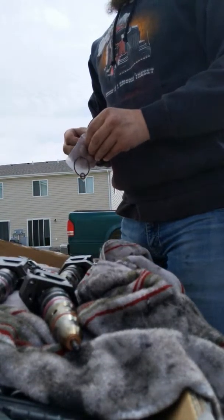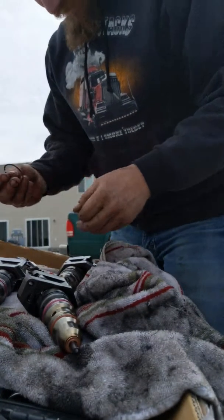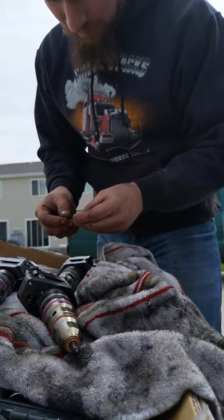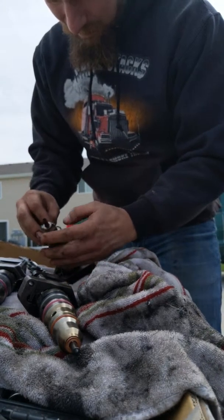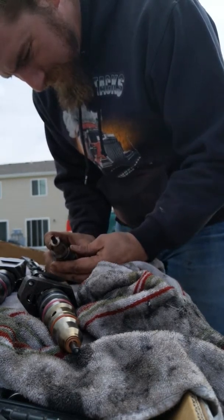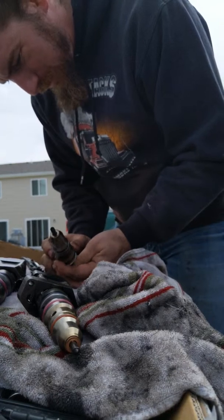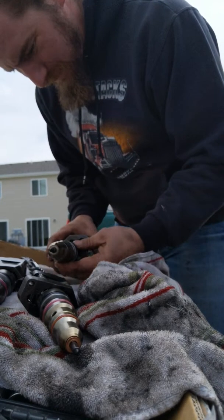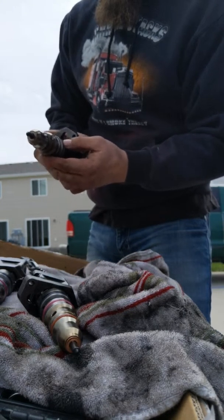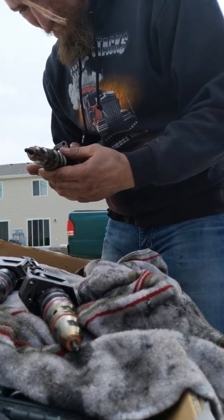We go backwards. That'll ring — now there's a sharp edge up and a smooth side. I'm putting the smooth side up and a sharp edge down, so that it kind of seats into the O-ring a little better. Just work it on up there, just like that.